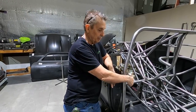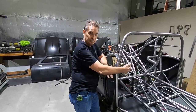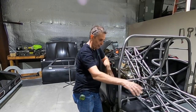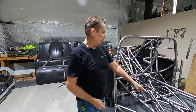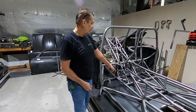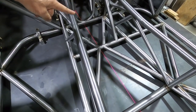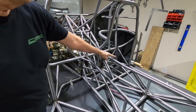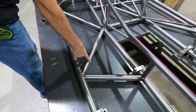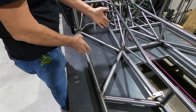Once that bar is in place, the next step is to run your two lower frame rails out, always in line with your four-link brackets. Width varies depending on the rear end. You put a kick in those bars, set them in the saddles, and get that ready. Then we put the cross member by the transmission, locate that bar, and put in the four pieces for the lower X, then the continuation to the outside rocker bar and the two little bars under the seat.